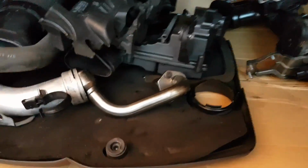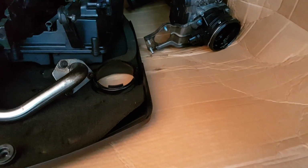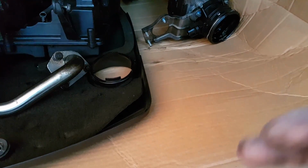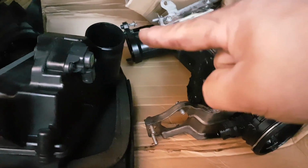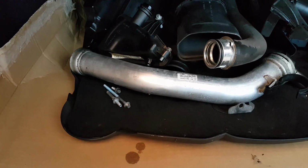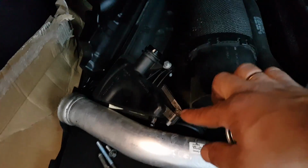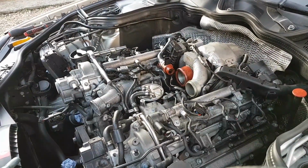There is one thing, guys, that I think is worth mentioning. If I had a workshop, I would do things slightly differently, but I don't. Especially on these Mercedes, and there are other cars too, you have bolts of different lengths, and you can get mistaken. If you put a long bolt in a place where it should be a short one, you can damage it, you can snap it. So to make sure you get it right, what I usually do is the following, as you can see here. I put everything like that, and I just put the screws roughly back where they should be, right there at the back. You see all the bolts kind of in place. When there's nothing to put the bolts on, I just put them like that. That's what I do to make sure I don't get anything in the wrong place when I put it back. It's just a technique. You might use something different. If I had a proper workshop, I would do it differently, but I don't, so that's how I do it.